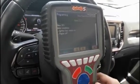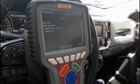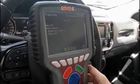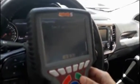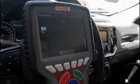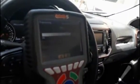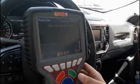We are going to do this function. Here, for doing this we need to have the ignition key in the ON position and the engine off. So we are going to do the new ECU programming. Confirm the operation — yes. Turn off ignition and press yes. Now we have to wait a few seconds. This procedure is done when you replace an ECU of the vehicle for a new one.